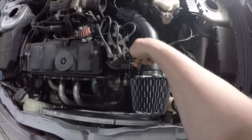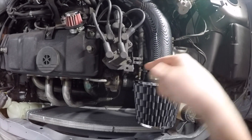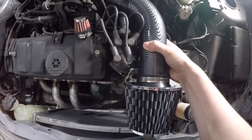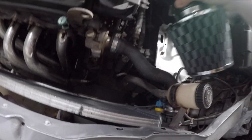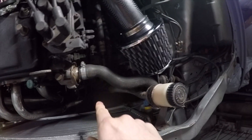What we could do actually is just get rid of this mount here, because that doesn't look like we're going to need it - we can mount it off of this one instead, which will then bring that sort of a lot closer and we'll be able to get it slightly further down. It's a shame really that there's this pipe for the intercooler in the way, because we'd be quite well placed to just bin that off.